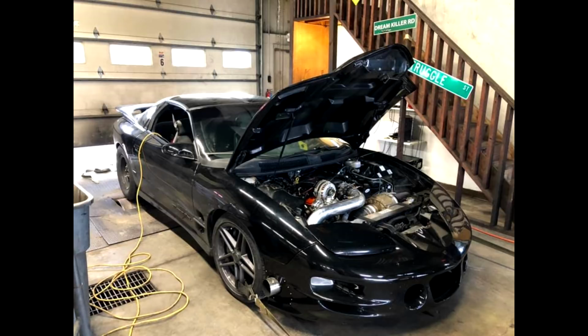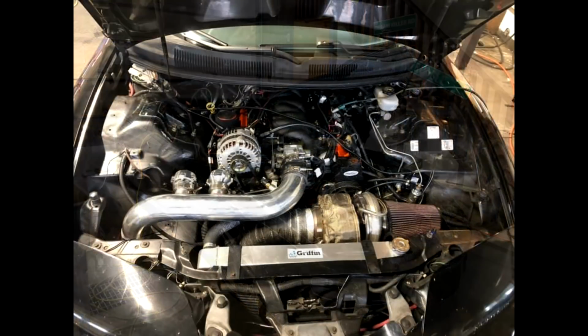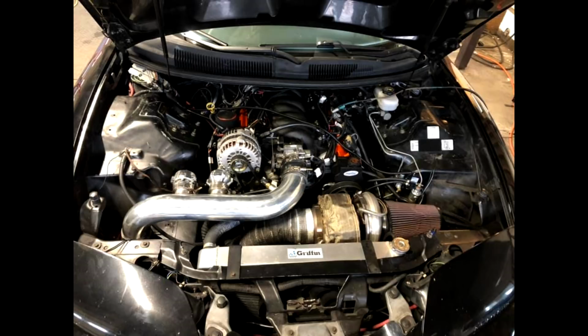Charles, it's a Trans Am, like a 99 or 02 or somewhere in between. I'm not exactly sure. Anyway, it has a VSracing billet 88mm with the 88 turbine T6 turbo. It's running pump ethanol fuel. It has Bosch 210s in it. It is an iron 370, of which I don't think is very exotic with heads or intake. Almost looks like that's an LS1 intake from this picture.